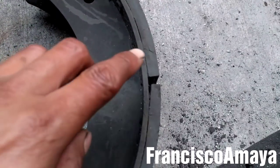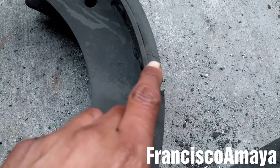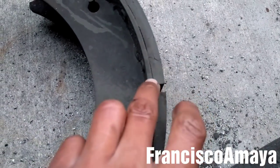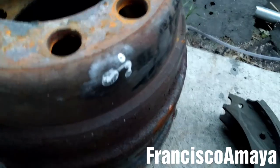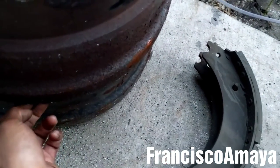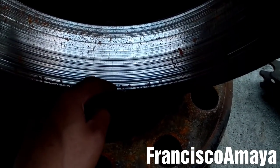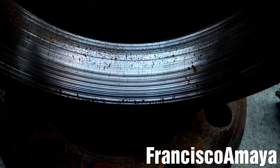When I talk about cracks, I'm talking about this kind of crack — you can see this one here, this is a really bad crack. It's very visible, so if DOT officers see this they're gonna pull you out of service. When you are inspecting your drums, you have to check for a groove in the contact area with the brakes. If this groove is big enough where you can hide the tip of your finger, you need to replace the brake drums.